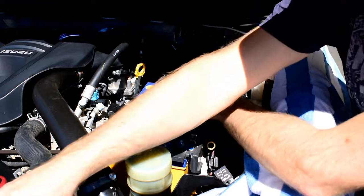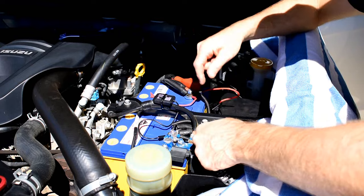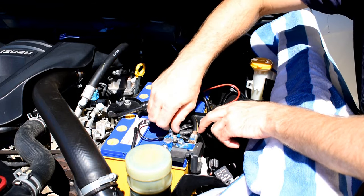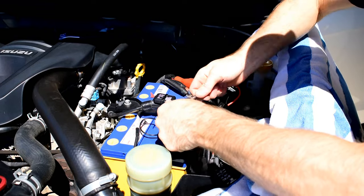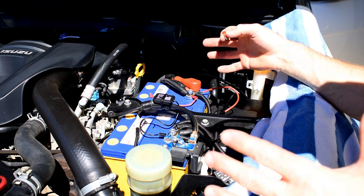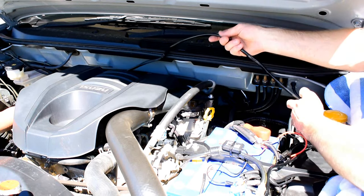Run the power and earth to the battery, put the washer on, and tighten everything up nice and tight. Just remember that you've taken the fuse out, because later on when you jump in the car after finishing the job, you might go to flick your light bar on and run around thinking something's wrong — but it's just because you pulled the fuse to keep it safe to work on. Now that we've got power and earth connected with the fuse out, we can run our wiring over to the light bar.